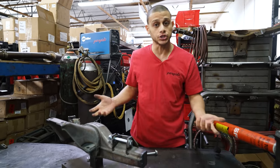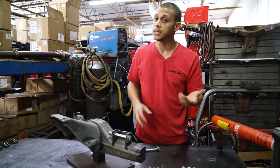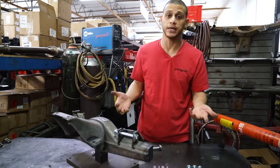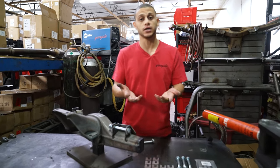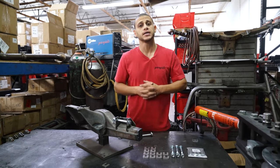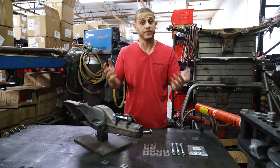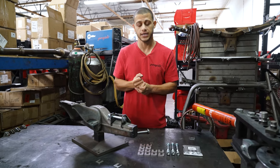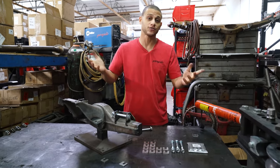You don't get the infinite adjustment of the eccentric hardware, but you also don't have it getting knocked loose all the time. This is a very popular practice not only with spec E30 racers but also Miata spec racers and other racing sanctions who have very similar camber and toe brackets. If you have any questions, leave a comment below. Let us know how we can improve on this product or if there's anything you'd like explained. Thanks for watching.